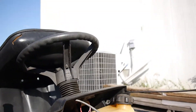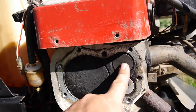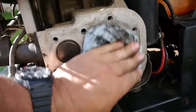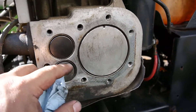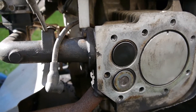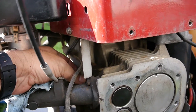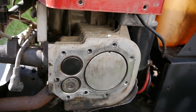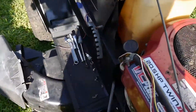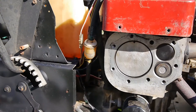Sorry about the noise — we're right by the AC over there. I'll do the same: clean all the carbon deposits off and check the valves. I cleaned them off and checked around the valves and they're seating well, so they actually look good. It still runs rough of course. Here's the cover for the valve springs — from there you take the springs off, take the valves off, and lap them and all that, but this one's actually okay.